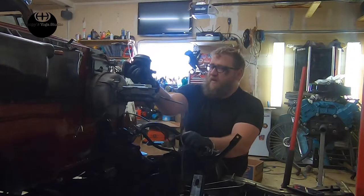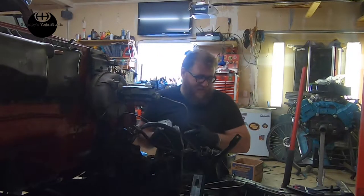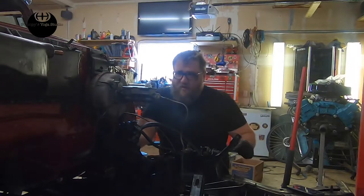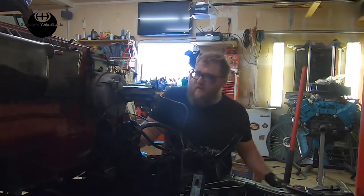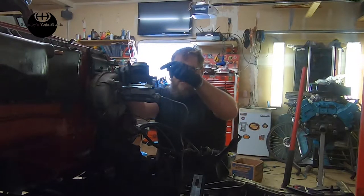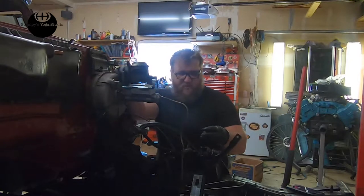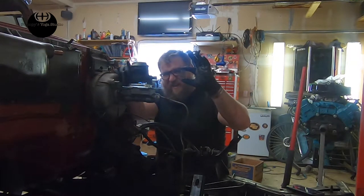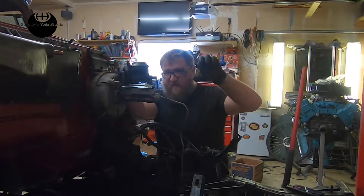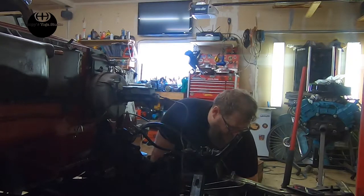And this bolts right up where that did. That's kind of nice. This is the original brake booster, so this has power brakes. But that's why we're going down this path. The problem with that is that if you see where this used to sit, this used to feed into the end of there. And that would be it. And there's a distribution block, which looks a lot like this, sitting down there, the other way. And that just is your distribution to your brakes.